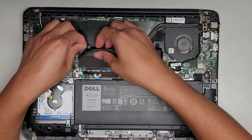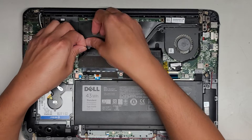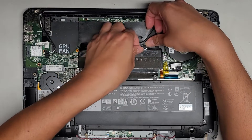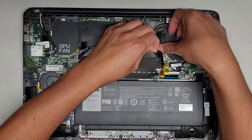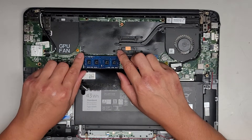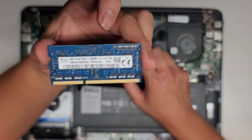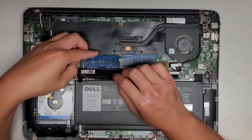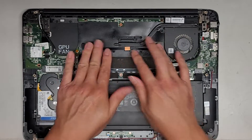Let's see if we can open the RAM connector — we're going to peel this up. You want to be careful because they put rounded cuts here that will make it likely to tear if you're not careful. There's another pull tab here you can use to help peel it up. Here you can see the two sticks of RAM. Pull these two tabs aside, it pops up, then you can slide it out. This is PC3L-12800S — a four gig stick. Usually you can put any PC3L-12800S as long as the speed matches. You can put two eight gig sticks or two 16 gig sticks if you can find them.